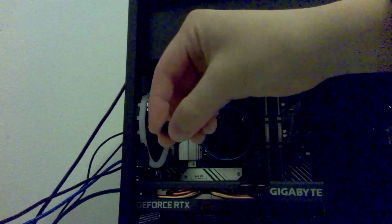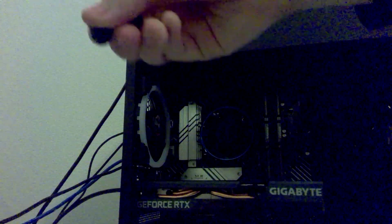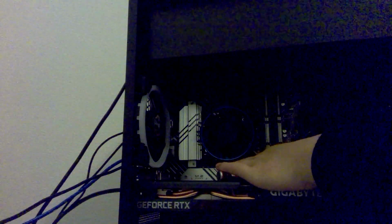Thumb screws, super great. Great of Rosewill to do this, but everyone has thumb screws now, so it's really not a special feature. Get my screwdriver. I saw Bitwit or someone also use the same screwdriver, but with glue. That was pretty interesting. I'm just gonna unscrew this screw for the M.2 heatsink right here. It's not absolutely something you need, but motherboards all have this anyways, so it really does not matter these days. I'd rather put it under here because it's the faster slot.